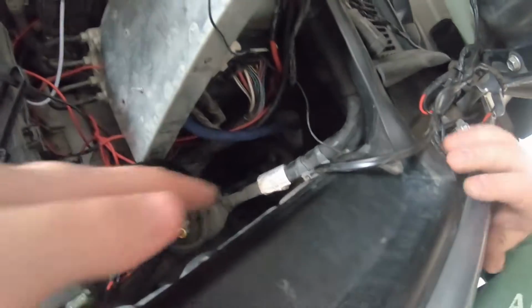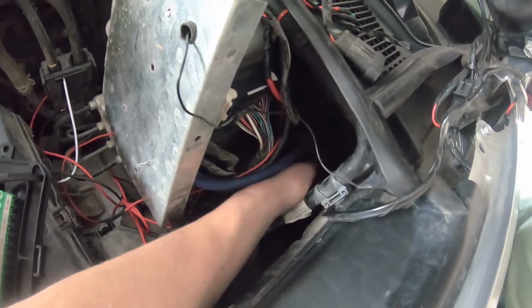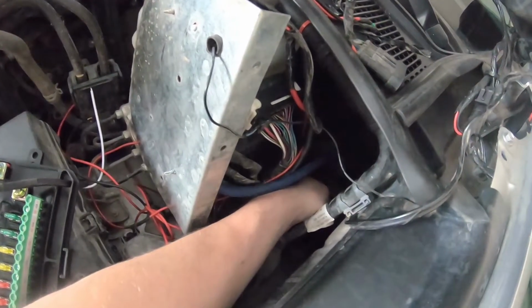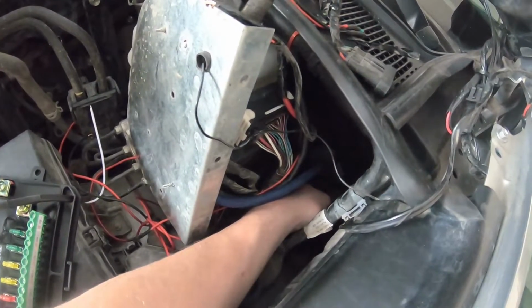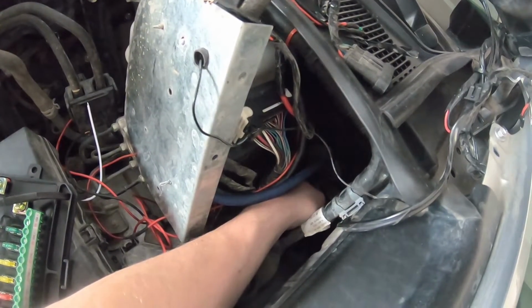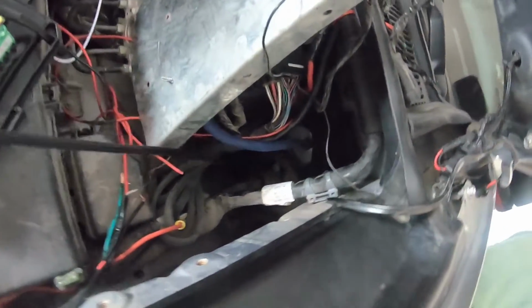So the way to do it, guys, is that you'll find your cable down here on the top above your wiring harness. If you go off to the left of it, so it'd be inside the cab on the right, cut a little hole with a knife or razor blade, and then just start pushing it through there, and then it will fish through down in here.